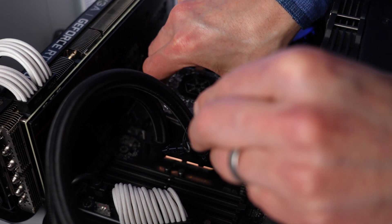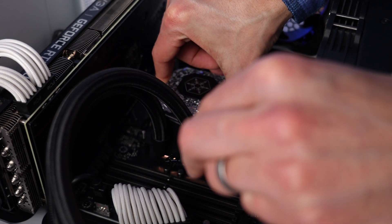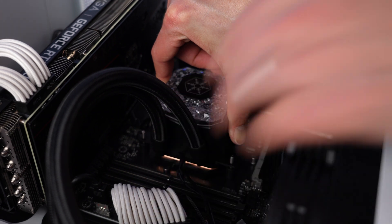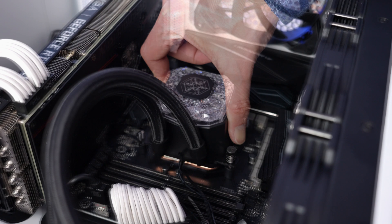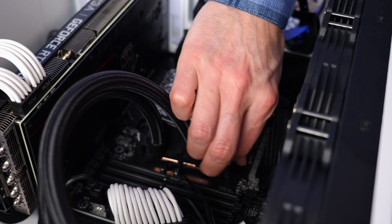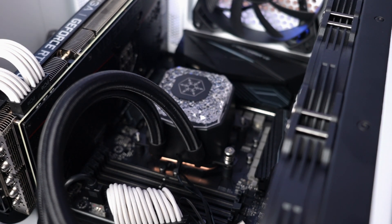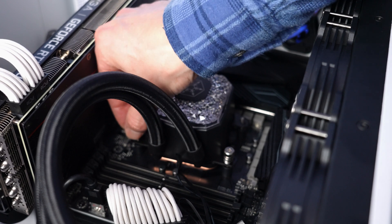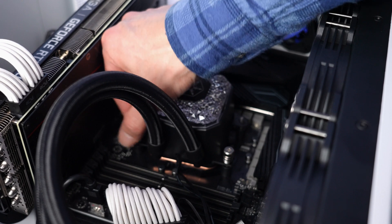You won't even know that's happening, which means you could get a very bad mount on your heat transfer plate — uneven pressure without realizing it. I actually decided I had to maneuver this so I had a hand behind the motherboard as I screwed these on with my fingers only and not a screwdriver. I got them into place secure enough that the posts wouldn't slide through, and then came back a little bit later and tightened them with a screwdriver.